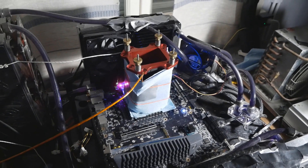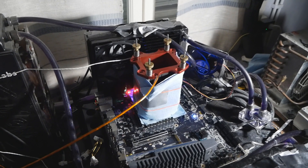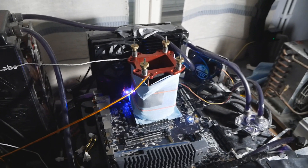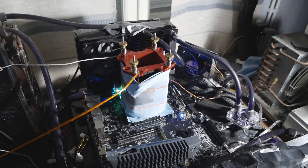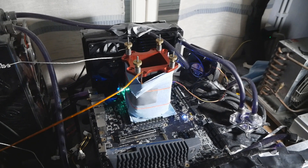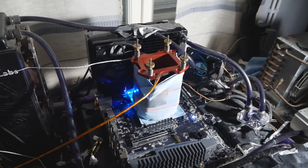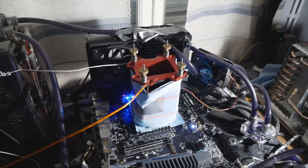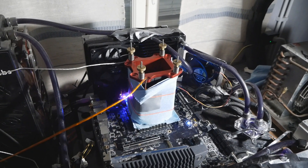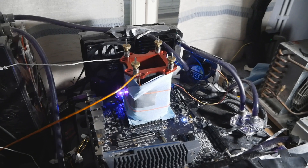It's time to test the brand new G7400 which I got from China — a retail one but with AVX512. Based on my findings with the G7400, you can't predict how well the CPU can do on LN2 based on just VID and water cooling results. The target is pretty high, like 6.4 to 6.5GHz, so we will be trying Ycruncher, R15, R20, Geekbench 3, etc.